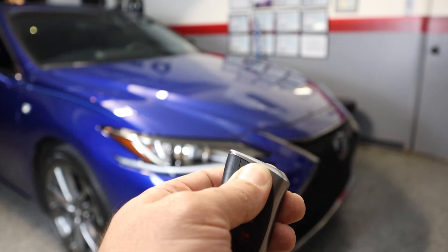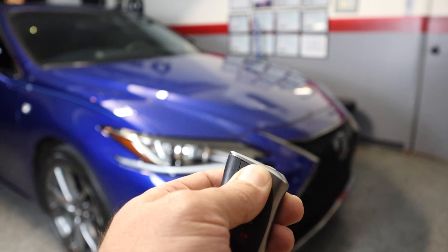Another thing about this model is remote start. You might know you can subscribe to a connected service and use the app, but did you know you can actually remote start with the key itself? Just press lock once, press lock twice, and then the third time press and hold it until the lights start flashing — and the car starts. Whether you have the subscription or not, the remote start from the key fob will still work. It's limited by the range of the remote, but if the car is parked right outside your window, you can remote start it for free — it comes included with the car.